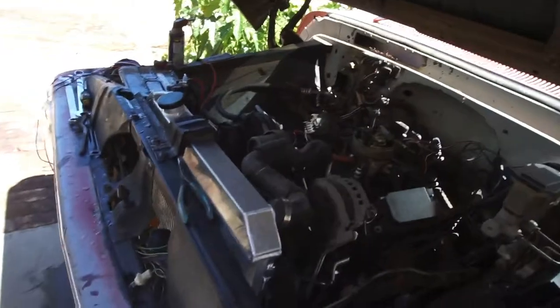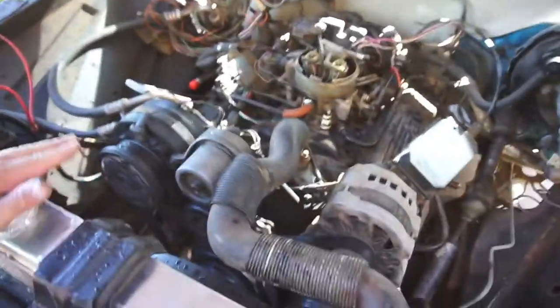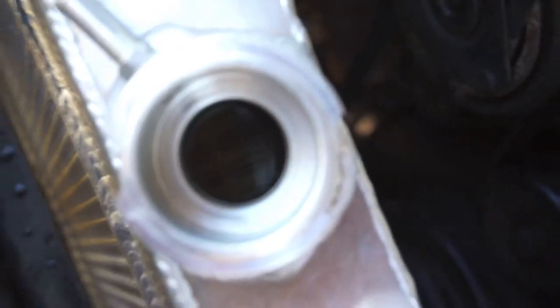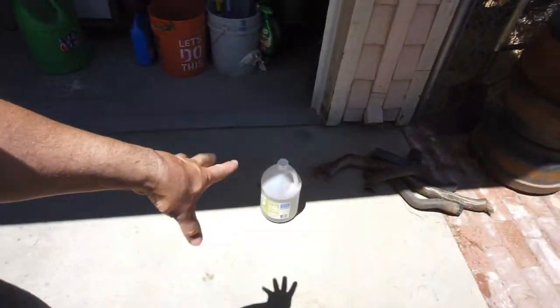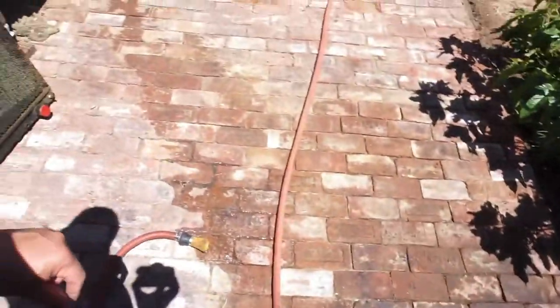Because I burned my hand. Got the radiator all installed. I got it all flushed out. You can see the fins down in there. Stuff was nasty. It took probably like 100 gallons to flush this junk out. And I was using vinegar. Vinegar flushed it out. All kinds of nasty brown and black crap came out.